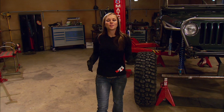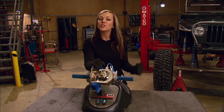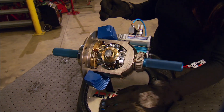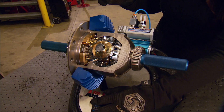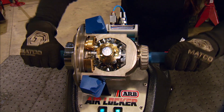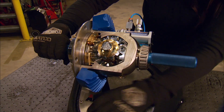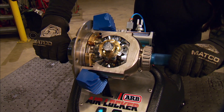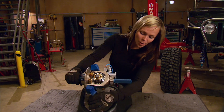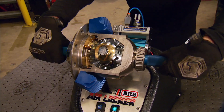When it comes to lockers for this project, we had a lot of choices, but we opted for the ARB air lockers both front and rear. This cutaway shows that when the ARB air solenoid is activated, the locking ring slides over the side gear alignment tab, completely locking it in place. Even if the two aren't fully aligned, the locker will still activate, and once the axle turns just the slightest bit, the locking ring will move into its lock position. Once the air pressure is released, the differential works as it normally would, driving and turning just like an open carrier.